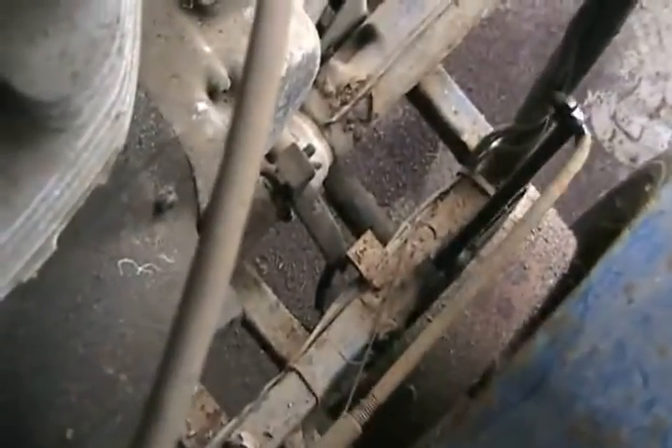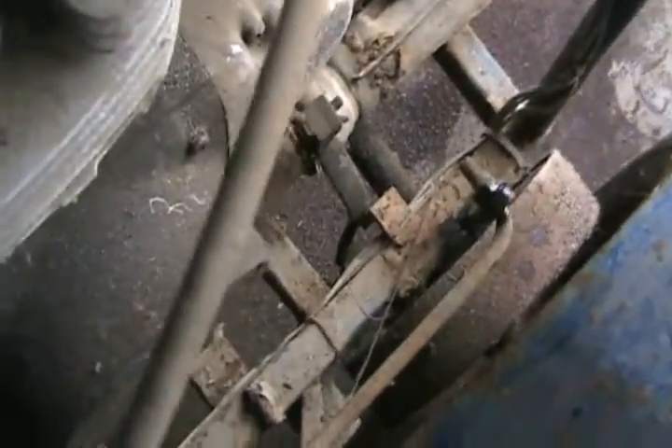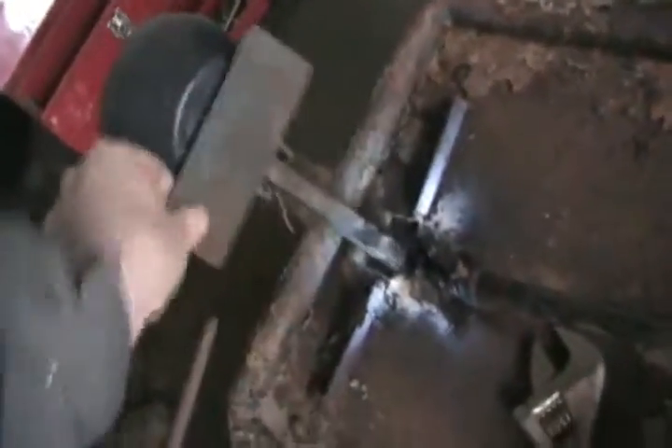I think the pivot point on the brake is seized too. With some more torch action, you can see my brake drum under there. Now I have my rear pivot and my brake actuator arm functioning correctly. Just gotta hook it up to the brake pedal since that's working now. Sweet! Linkage just hooked up and it feels like we have brakes.